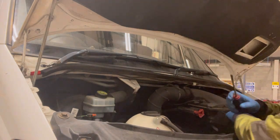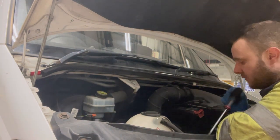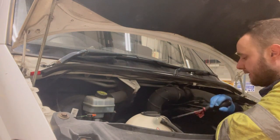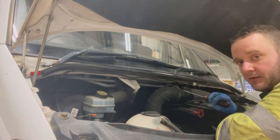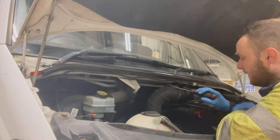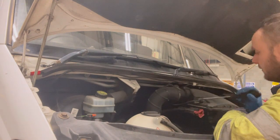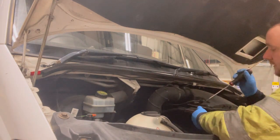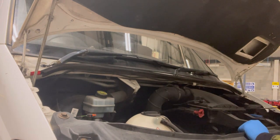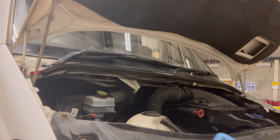Let's start with the front. I'm going to take the air box off first because we need to get to the oil filter, which is down here. To get the air filter off, I'm going to do this clip here, that clip, get the plug out of the way, the positive port here — these pull out. Take the pipe off here, and then same with the oil filter part there. I'll get a torch so we can see it all a bit better.